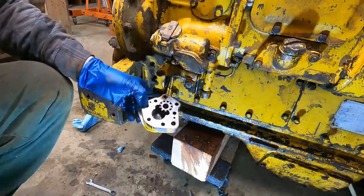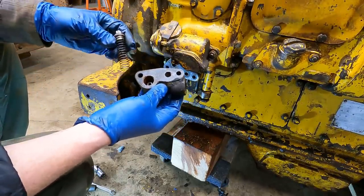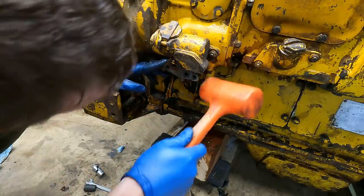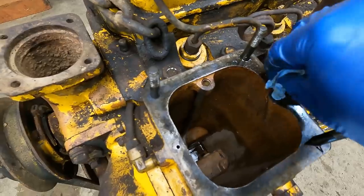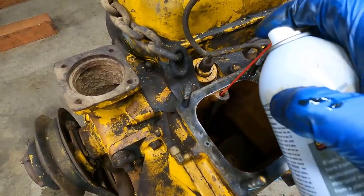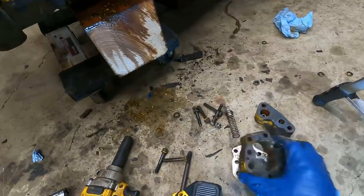I sprayed in a ton of brake cleaner and it filled all the way to the top and wasn't coming out, but it's dripping out the back, so I know that passage is clear. I'll just stop taking it apart at this point. Any water and fuel is going to settle to the bottom — that's where it had settled and that's why there's grit and crap in there. Got it pretty cleaned out; there was a lot of sludge on the bottom. Once the brake cleaner dries out I'll vacuum that out.